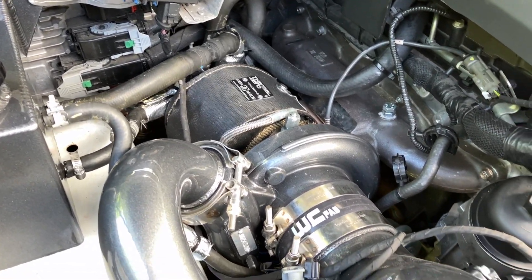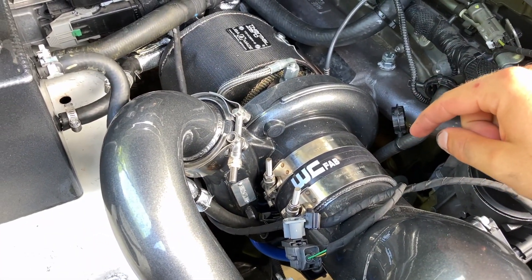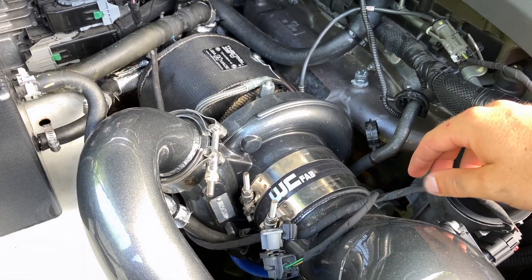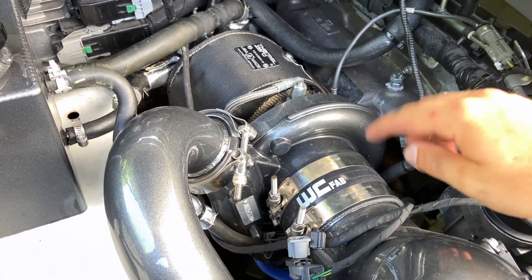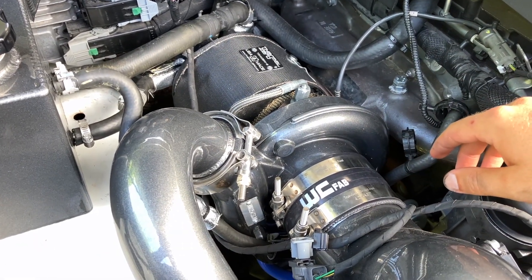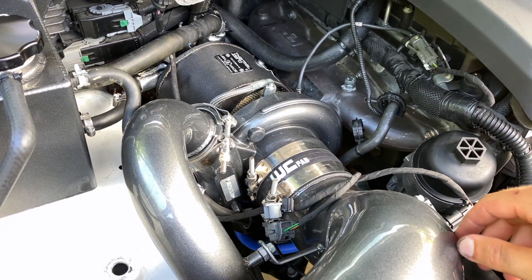Pretty straightforward install. The main benefit of this system — among other things, but from a maintenance standpoint — it's very easy to boost test this truck because the turbocharger is up here at the top of the engine, and you're not trying to snake the faceplate for a boost tester down next to the side of the block. This has been a real treat and it makes it pretty much inexcusable if you're going to boost test that truck every oil change. You pretty much have no excuse — it's just a couple of clamps and you get right to the face of the turbocharger.